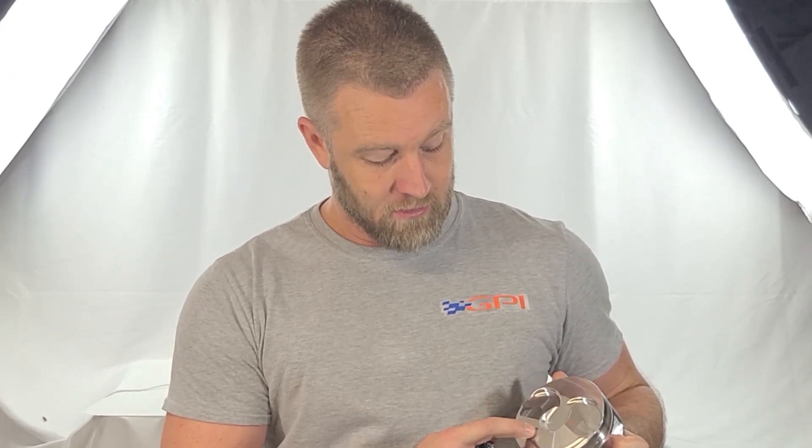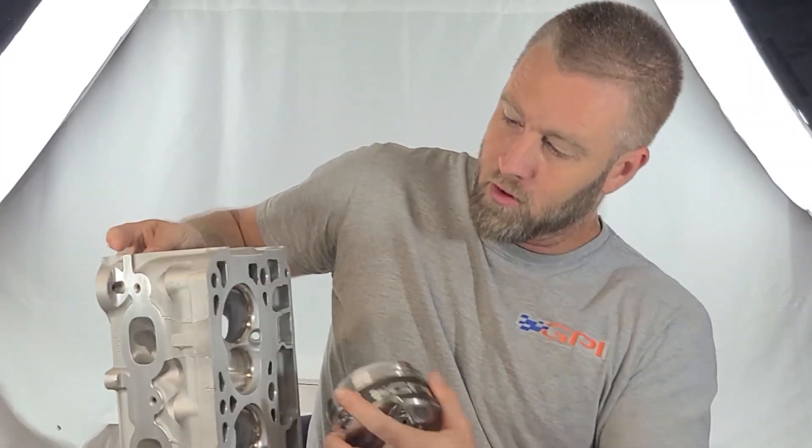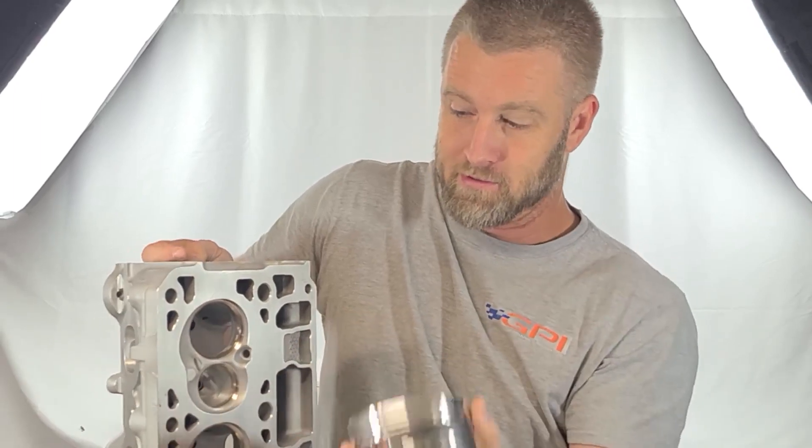The first thing I want to show you — our drop-in piston setup has a dish that's cut out when the piston is manufactured. This is not for the spark plug electrode; this is for the actual quench pad on the cylinder head. That is not for the spark plug tip. Where you're going to run into a potential issue is when you mill these heads 40, 50, 60 thousandths and run a 40 thousandths gasket. You can't run a 28 thousandths gasket with our drop-ins, because the compression height is different versus stock pistons — to maintain the factory compression ratio with the large valve reliefs, there's not enough quench.